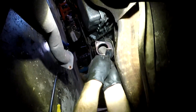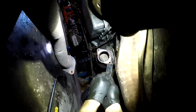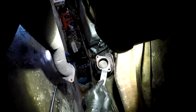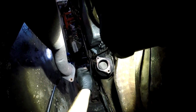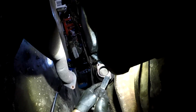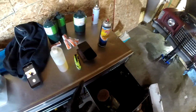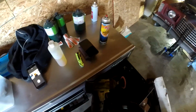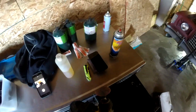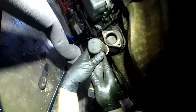Like I said before, this gasket probably has asbestos in it, so you definitely don't want to breathe it. It's okay to touch, just not to breathe. Like this fibrous stuff, that's asbestos. We don't want to breathe that. So I put on a dust mask, like a construction grade deal, and I'm going to take this Roll-Lock disc and get all that gasket material off. Like I said, I'm not sure that there's asbestos in it, but I want to play it safe. And I do this out of laziness. Sometimes the gasket scraper just takes forever, and I'm too lazy to deal with it.